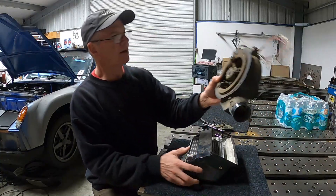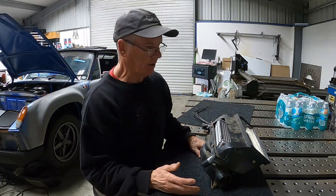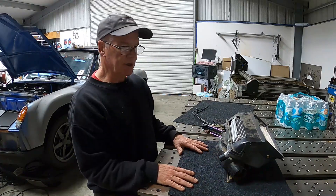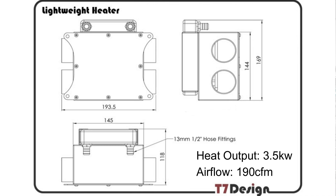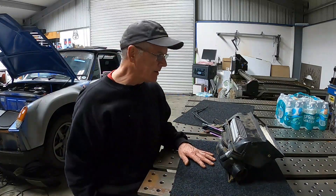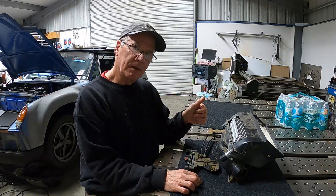I started down this path and then realized that this means I'm stuck with a pretty heavy, giant motor and a bunch of 914 parts which I'm not really going to use, because I don't care so much about blending heat — I really just want a rudimentary heater and a defrost. So I'm going to end up not using this, at least for the time being. I'm going to use this thing, which is designed for a classic mini. It's got a tiny little fan setup and a tiny little radiator setup. The specs indicate it's going to be putting out plenty of heat and cubic feet of air volume to warm this car up. And again, if it's three degrees below zero, I'm not driving this car anyway — so it's just a rudimentary heater. The issue is: how do I control a multi-speed system with one button? Let's go look at what we're going to do.